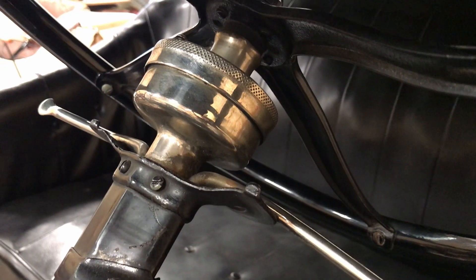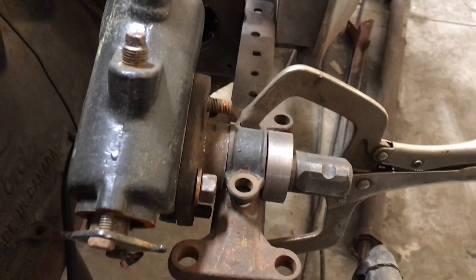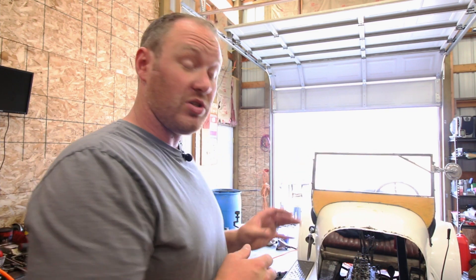The way that the Ford steering column works is that the steering gear is actually up at the top of the steering column, where all modern cars the steering gear is down at the bottom. You end up having to have a very strong structural frame component to take all the twists and torque. With the Ford steering gear, the firewall takes all of the torque — the body takes all the steering component torque — and it's all transferred through the steering column. Kind of obscure and weird, but it works surprisingly well. We're just going to go with that because it is tried, true, and frankly safer in this case.